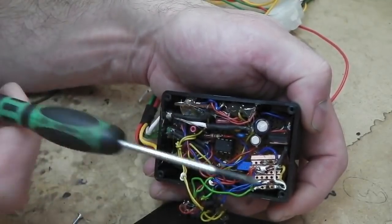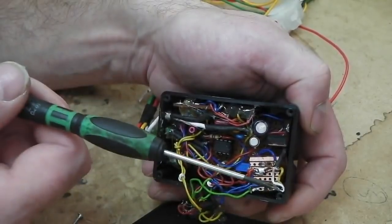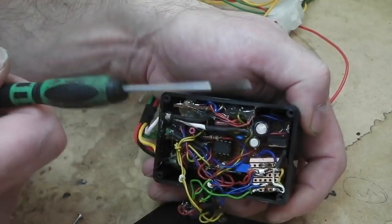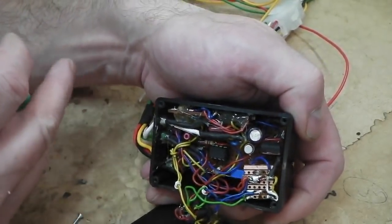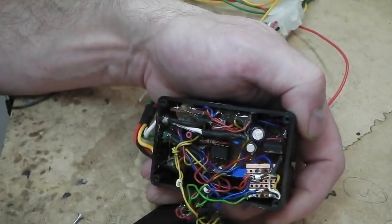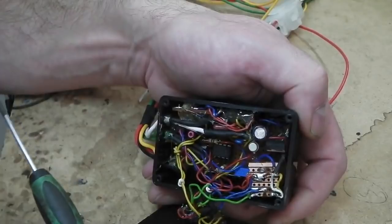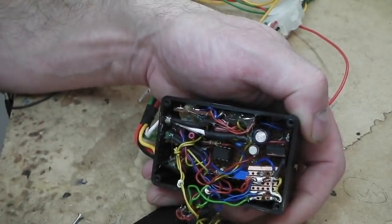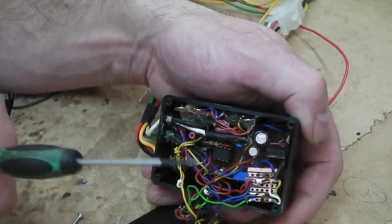And that's why on a kickdown solenoid on the side of your gearbox, it's got three wires: ground, heavy coil and light coil. And that's why you need a little control relay to operate that. It's called a kickdown relay. All Ford Granadas and all A4 boxes have a kickdown relay, which just does that main current, then a holding current. It's a little timer. I've got one that I pulled out of the Granada, which I'll be using. If you didn't have a kickdown relay, you can build one with a timer.